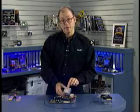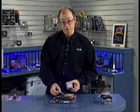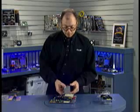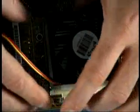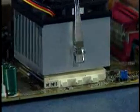Once you set the heat sink down on top of the processor, don't wiggle, twist, or slide it, because you'll tear the thermal interface material. If that happens, you'll have to scrape it all off and reapply separate thermal transfer grease from a syringe. What retains the heat sink to the motherboard is a stainless steel clip — each end engages over the tabs on the processor socket. I'm going to set this down and engage the tab on the back side.